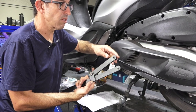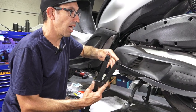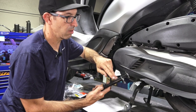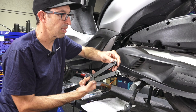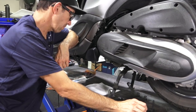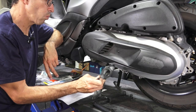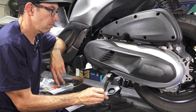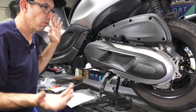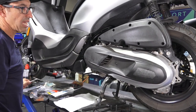Two tools you're going to need: the front variator locking tool, part number 020442Y — that's an original Piaggio tool. We have those specially made, and the replacements we have are better quality than the Piaggio one. This tool is very useful for other scooters too, like holding the clutch bell or flywheels that have a pair of pins. For locking up the rear driven pulley, the part number for that locking tool is 020917Y — also very important. The rest of the tools are just basic tools; I'll talk about them as I go.